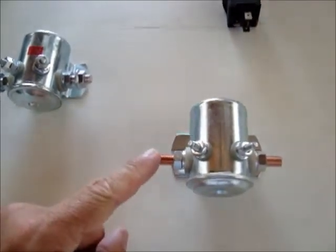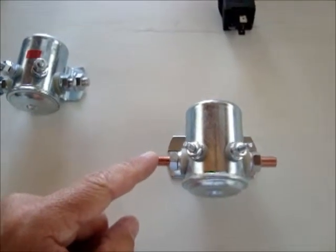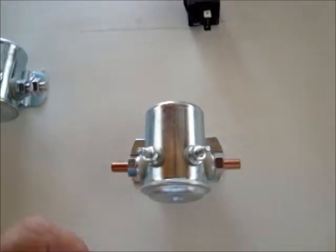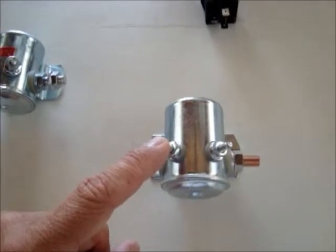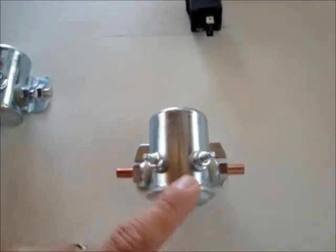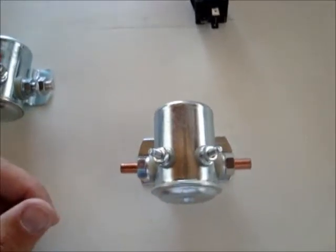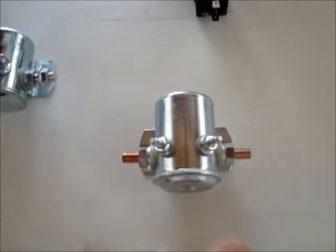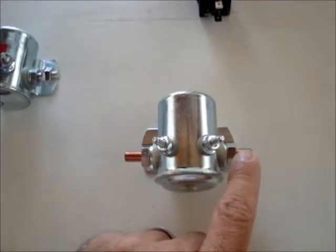The battery — 12 volts from the fuse — goes here towards the relay, and then here it goes to the cell. You put minus on this side, just ground that side, and on this side you put a 12-volt source. Whenever you connect it with a switch or something, this relay will connect these two posts with each other so the current goes through.